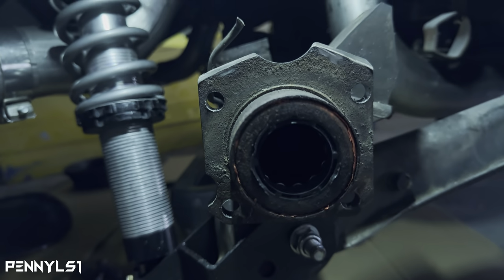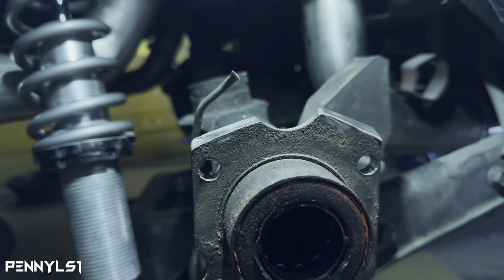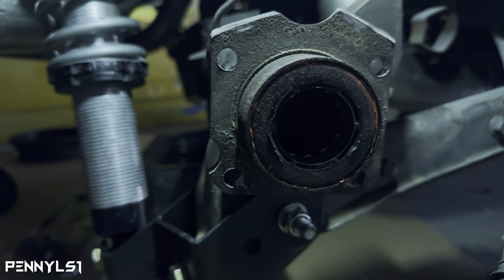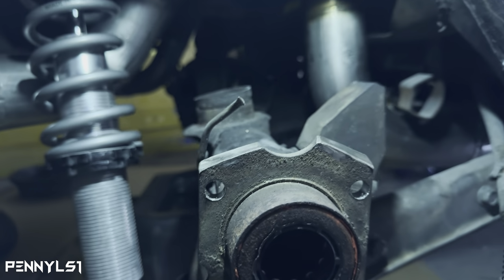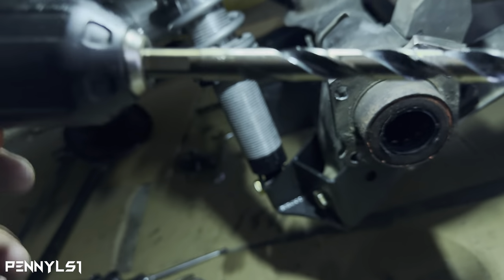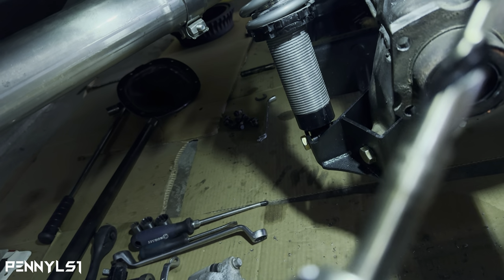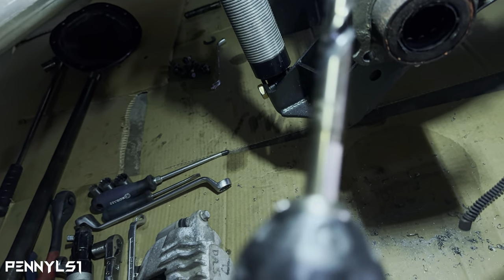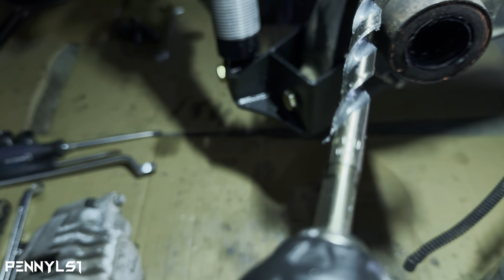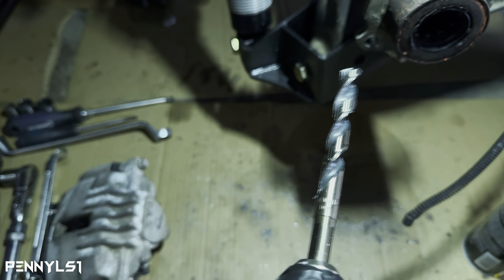Speaking of drill, the bottom holes are already in place. However, they are too small, so you will have to drill out the bottom holes, and then you will have to actually drill the top holes. The final size on that, which I don't think anybody had mentioned, at least unless they did and I missed it, is this big boy right here. This is a, what was it, 11/32? 13/32 on him. See if I can get it to focus. Probably not. But 13/32 is the actual size on that. You can barely see it, but it's pretty big.